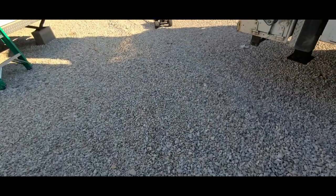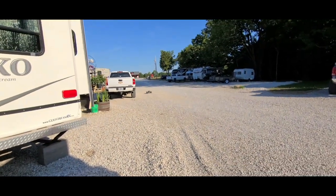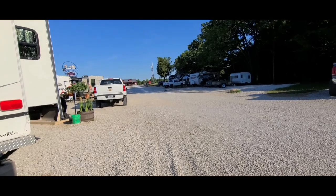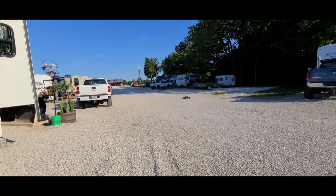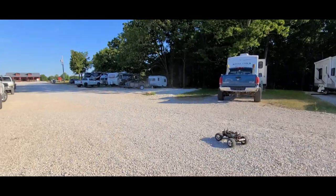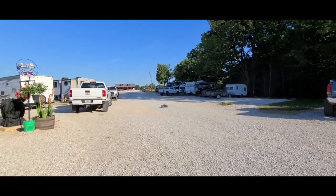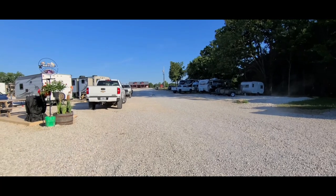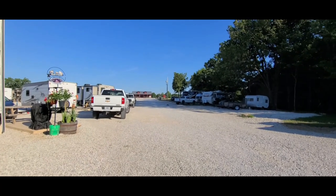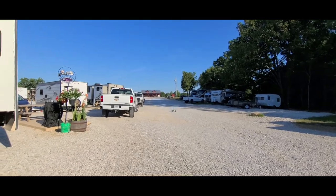So during this clip here, the truck was running really fat. If you can listen, you can tell that it's not shifting out into second. It's just barely revving up. So this was about 4.5 turns out. I turned it in a half a turn, and that really picked it up. So on the next clip, you'll see it really starting to pick up and run good.